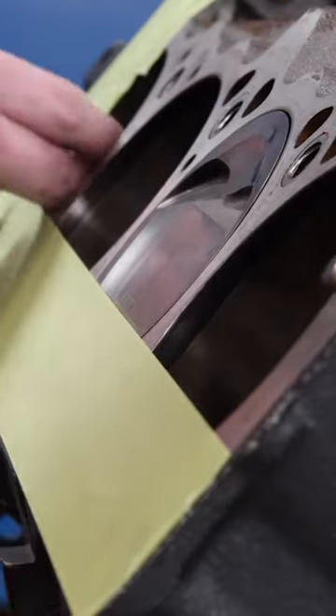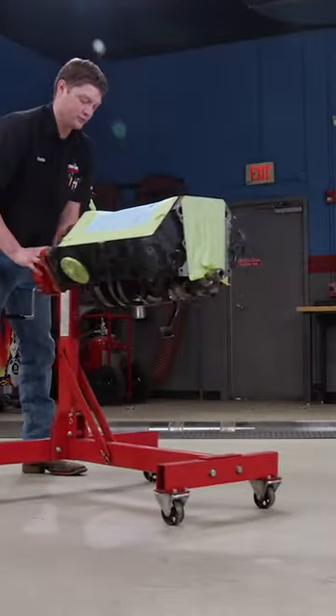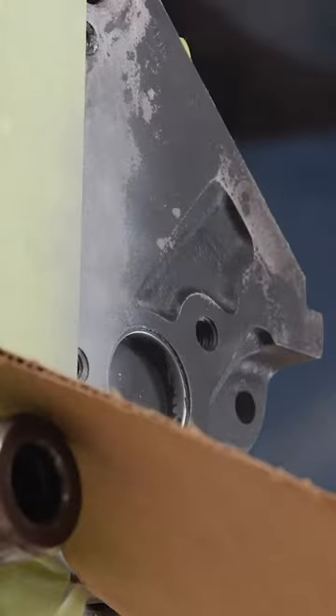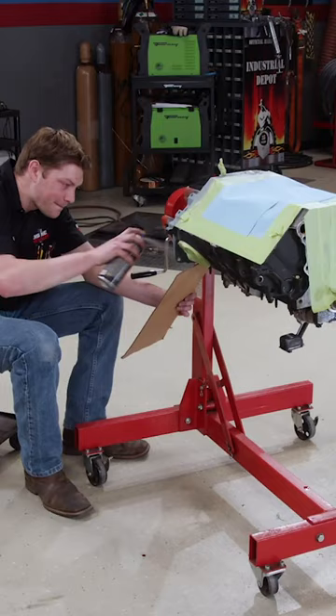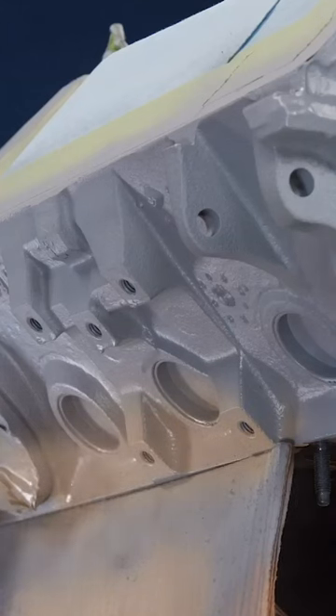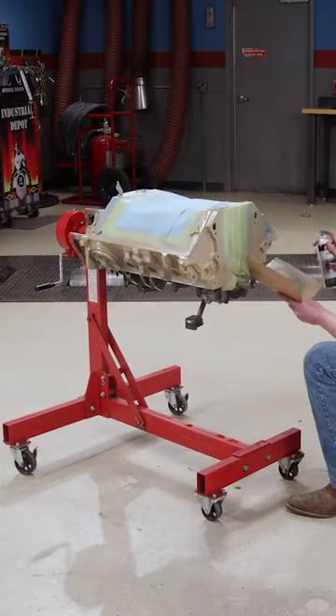Because the engine is fully assembled, we'll clean it by hand and mask it off. We'll put down a coat of primer first — this promotes adhesion, fights corrosion, and gives a solid base. This ensures consistent color when painting the engine. People don't associate beige with a hot rod engine, but we think this is gonna look really good when we're done — trust us.